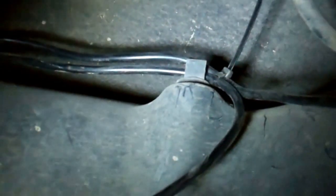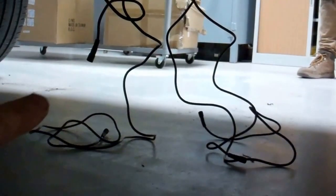Here we are underneath the Land Rover Discovery 3, now on the right-hand driver's side. We've come out a little further forward, in line with the front cross member, and threaded the cables over the chassis and up over the top. We've passed the cables over the top of the fuel tank and out next to the end of the gearbox — it's just found its own way over the top. There's a handy clip on top of the fuel tank. We now have all four cables dangling down in the middle, ready to be fed up into the inside.